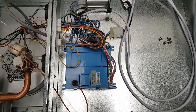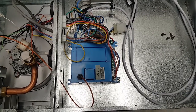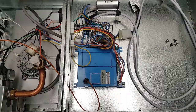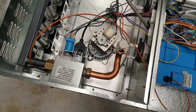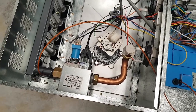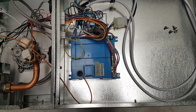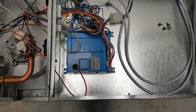So to start with, we've got that blue box which is the control module — that's the brains of the unit. The sensors throughout the unit report back to this module that things are okay or not okay, and from there it responds by providing power to the combustion fan, the gas valve, and the ignition. It constantly monitors feedback from these sensors all the time — this is what keeps you safe.